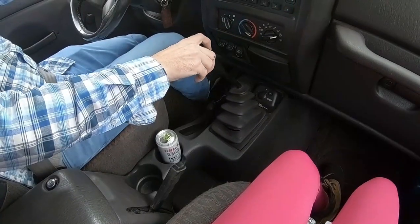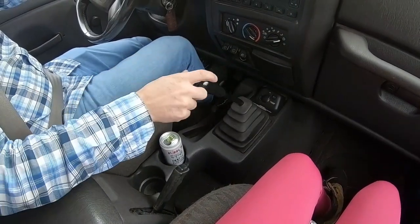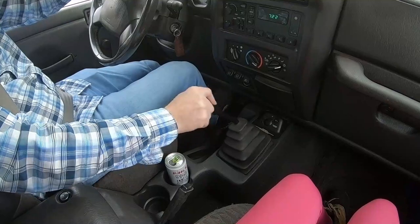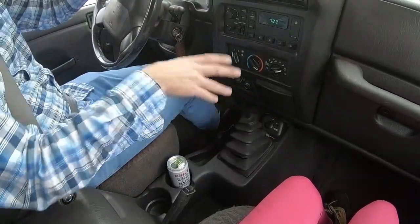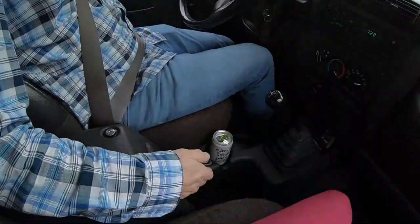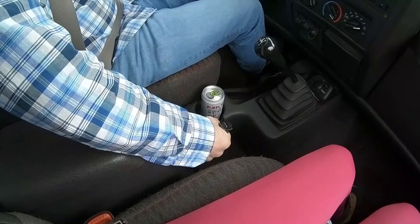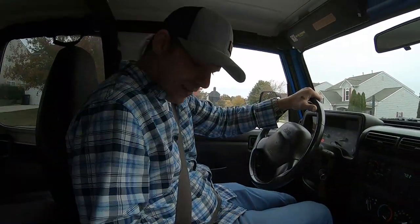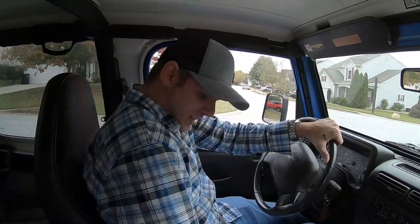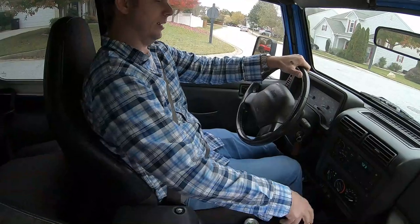You just know it's neutral — that was so easy. If you really need to know, just move it over once, good enough. The other thing I hate is snatching that e-brake up — it's not necessary. You feel a few clicks, you feel it taking on a little resistance, it's good. If you're jerking it up like that, you're stretching that cable, and eventually the cable is going to get so stretched you're going to have to make adjustments to your e-brake because it's not going to grip anymore. Stop snatching that brake handle up.